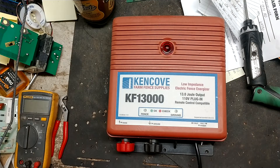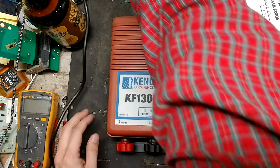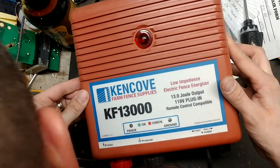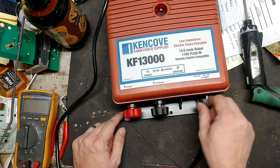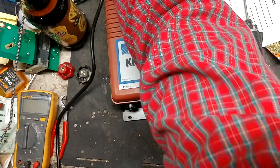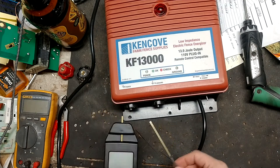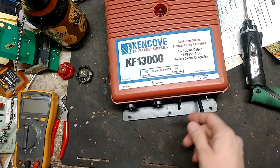We're going to plug this in - it's a 110/120-volt unit. When plugged in, there are a couple of lights that should light up red and green. It sounds a little funny. There's a half-power/full-power switch at the bottom - it's on half power, we'll turn it to full power. It's making a humming sound which is normal, but it seems like there's a longer delay to it. We're getting about a thousand volts out of it - on full power that's way off, so we're going to pop it apart.